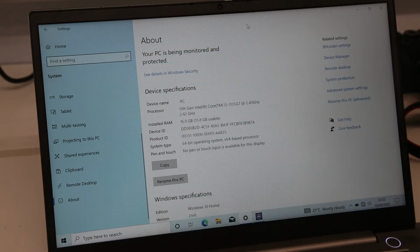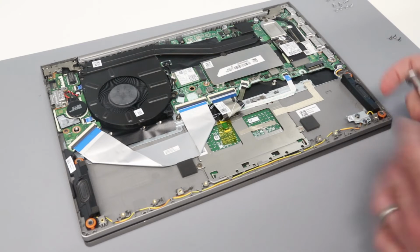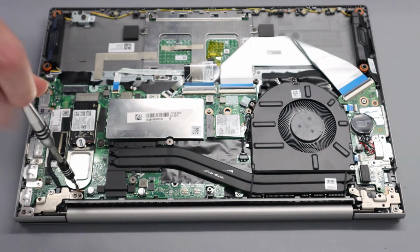Powering the system up after the upgrade, and we can see here it is correctly identifying the 16GB of RAM installed, and looking in CPU-Z, it is seeing it is in a dual channel configuration, and this is running at 3200 MHz to match the onboard memory. I'll include a link in the description to the parts that I used, and we have upgraded our machine to 16GB and dual channel.